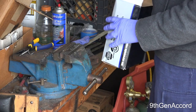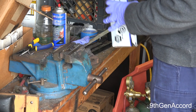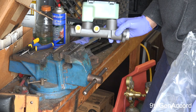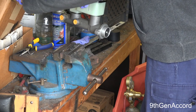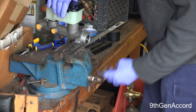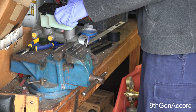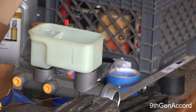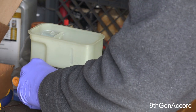I have a brand new master cylinder — this one happens to come from Napa — and it's got everything that you need. We're going to do a procedure called bench bleeding. I'm going to take the master cylinder and very gently put it in the vise. I'm going to pop the cap off and put it level. Now we need to get our bleeder set. I'm going to be using the Dorman — I was going to make my own but I couldn't get all the pieces that I needed.